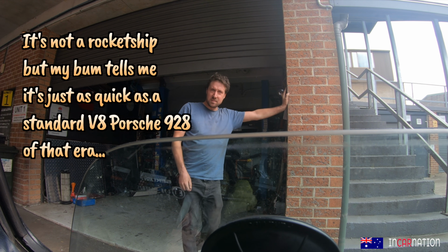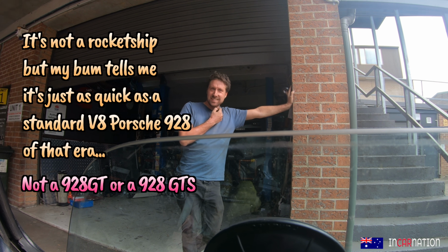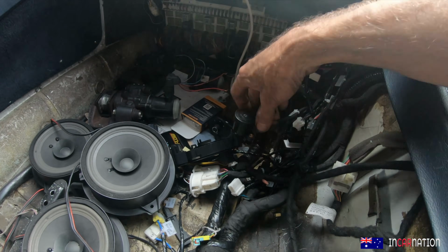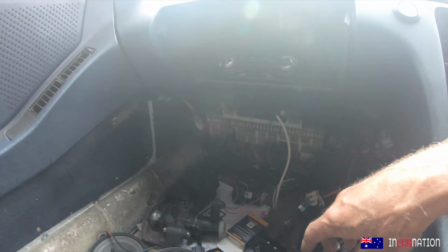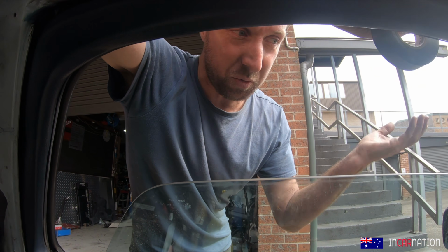Yeah. That was faster. Did you get to 100% on the throttle? I was too busy looking at the driveway. Yeah. It was close, but it was good. Whatever it was fine. So that was this guy here. This is the rheostat that was on the brake, and you've taped it in a position now where wherever it is, it's not holding the bloody thing back. It's going now. Yeah, it felt like that's where it had max power, which is cranked one way.